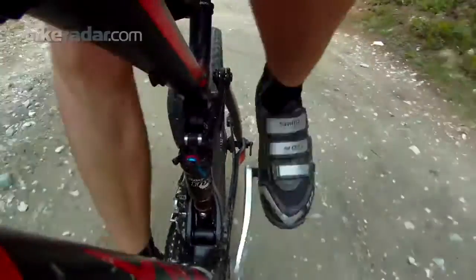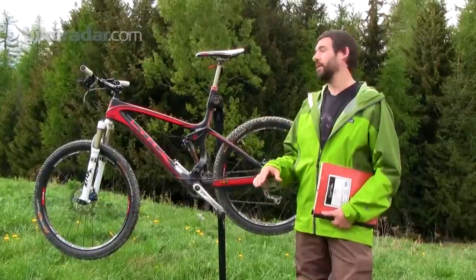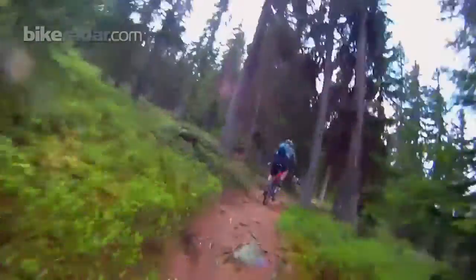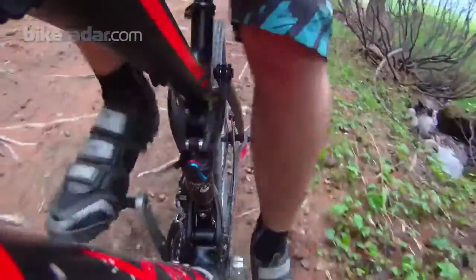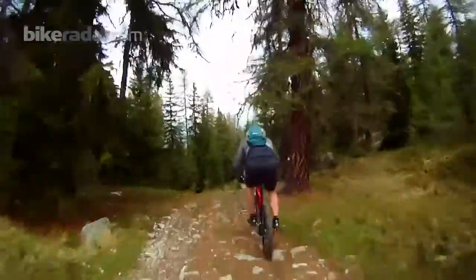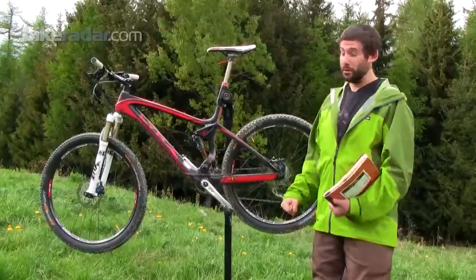It's allowing us to run some pretty aggressive tuning on the bikes. We're actually running 150 psi on the Fox Kashima shocks in the boost valve — it's the only bike in Europe using this level, this low of a pressure. Every other competitor bike is actually closer to 200 psi, which is just a testament to how well the bike is actually working on the trails. We're using a low velocity tune and medium rebound, which ultimately translates to a bike that's really supple on the small bumps but at the same time accelerates like you'd expect a hundred millimeter bike to, and also has a good amount of mid-travel cornering support so you can come into a corner really hot and push the bike almost like a slalom bike.